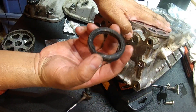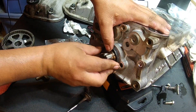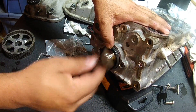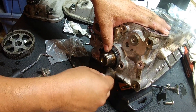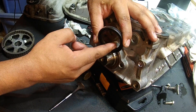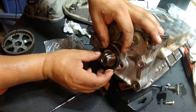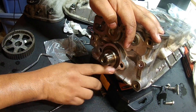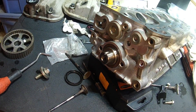I ended up taking the old camshaft gasket and an old valve stem and just pushed here with the flat part until the inner ring was level with the end of the camshaft — you can see kind of right there. Then take your finger — feels pretty good right there.